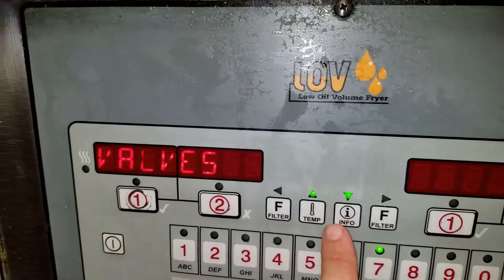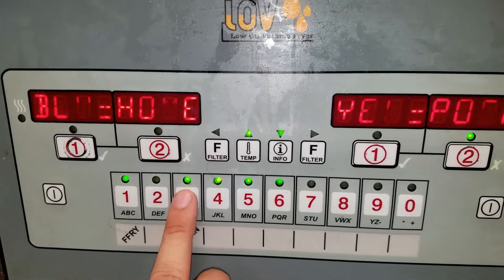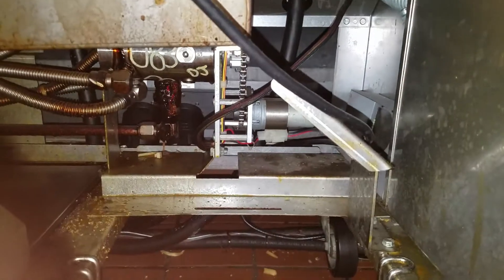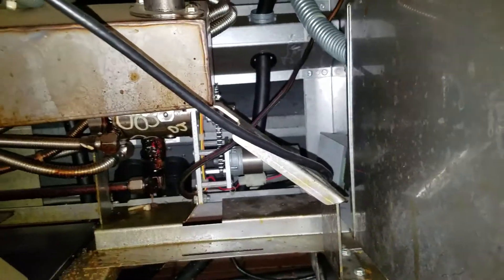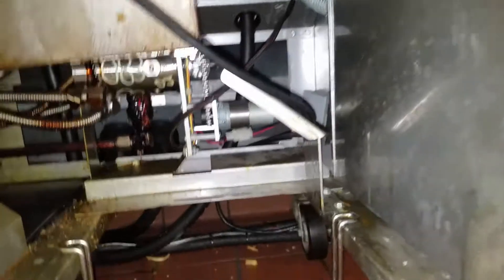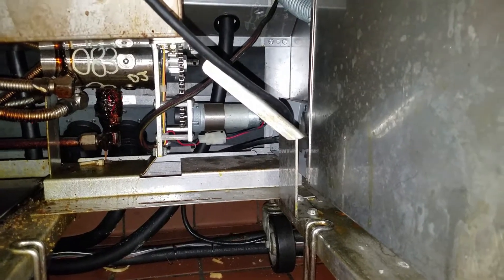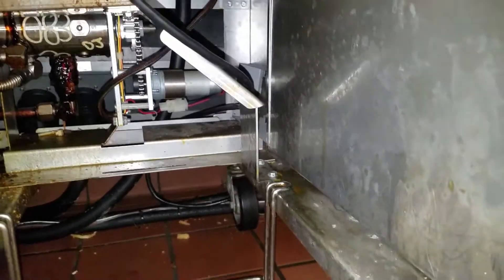You can use these arrows to scroll down to where it says 'calibrate selector valve.' Push number three to calibrate and you'll notice down here the motor doesn't want to run, but if I tap on it, it will run — which tells me the motor's going bad. Now it's starting to spin intermittently, which confirms the motor is going bad. It's getting voltage, the connection's good, so it's going to need a motor. We also notice it's missing its cover.